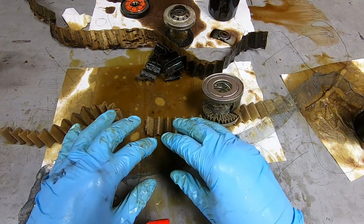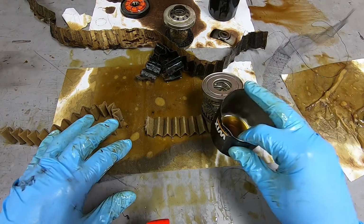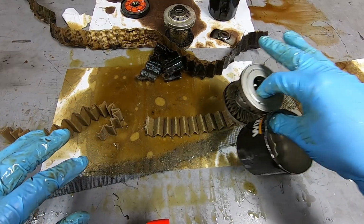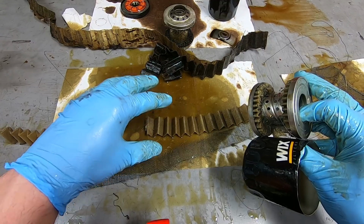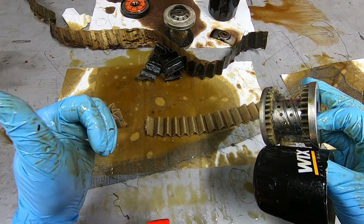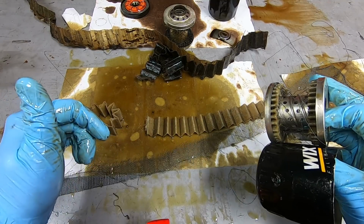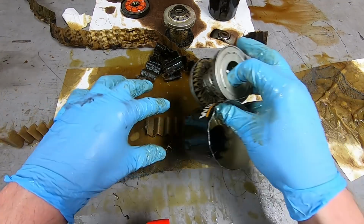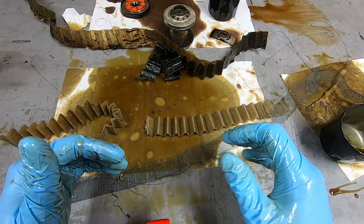But we got our answer. There's a whole poop load of metal in the Wix oil filter that came from this engine that's making a noise. But if you haven't seen where all of this metal mess came from, check the link down below in the description. There's going to be a link to the Milwaukee 8 that's making a whole lot of engine noise, and that's how we got into cutting open the oil filter and seeing all of the metal. So now we know that we're definitely taking the engine apart.